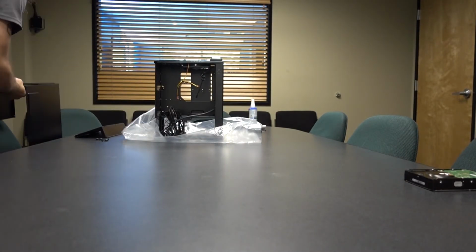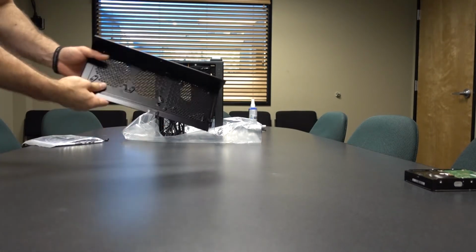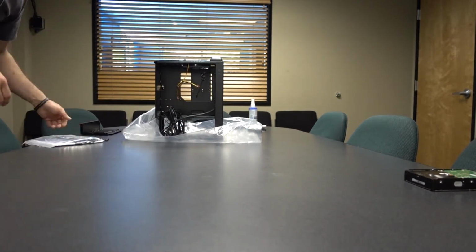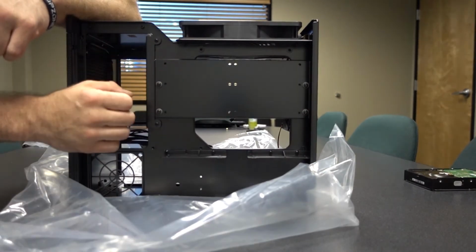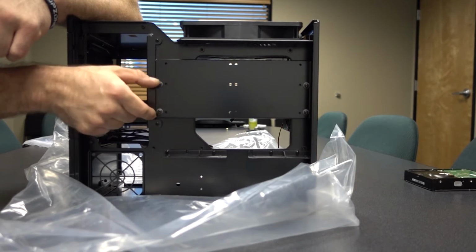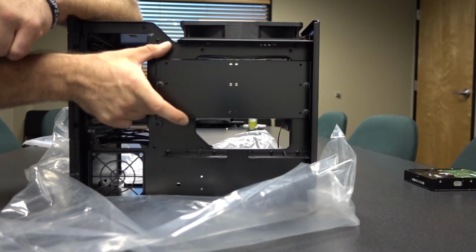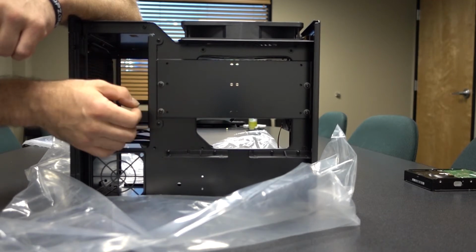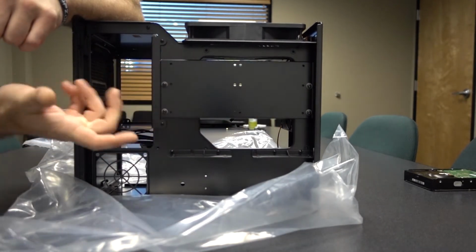I'm going to need these screws to show you about the Platter drive mounting. Another thing that's a little different from the retail version is there's no fan here, because we were always just taking it out and tossing them aside anyway. So let's get on to what I was talking about, the Platter drive mounting. In the Puget Systems edition of this, we have a custom bracket here. They've made it a little taller for us so that we can mount, I think it's like the 10 terabyte golds, which have a different mounting than your standard drives. They're kind of more like for rack mounts and stuff. So basically they gave us these extra holes across the top to mount those.